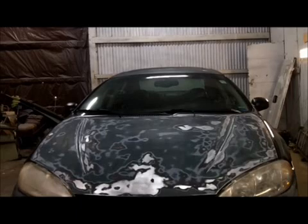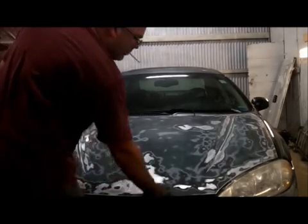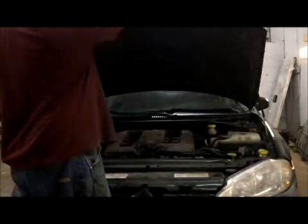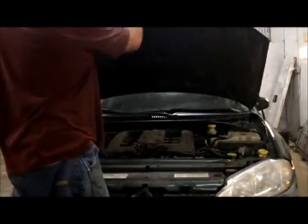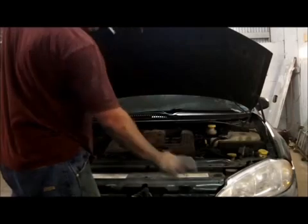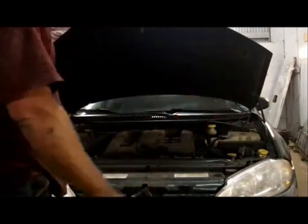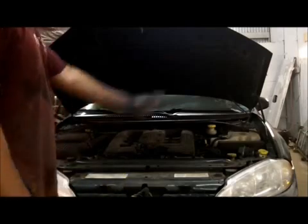So let me see, guys, if I do have some 2-inch. I thought I had some more, but I'm going to have to hunt around. Alright guys, I did find a little bit here, so we'll just use it till we run out. What I'm going to do is back tape the edges of this hood, all except for the front edge. Only because we have to paint the bumper. If we weren't painting the bumper, I'd go ahead and back tape the whole thing and drop the paper around, but we can't because we're doing the front bumper.